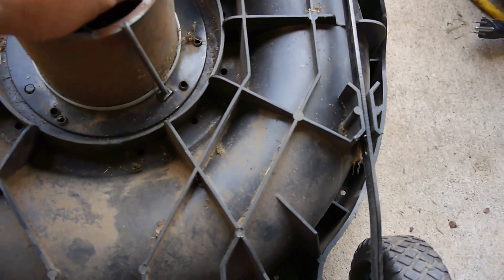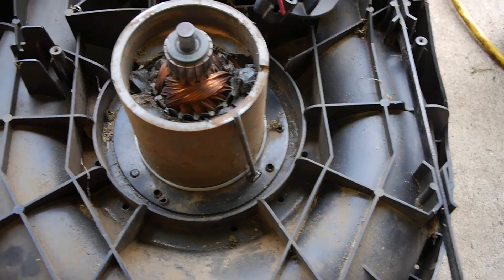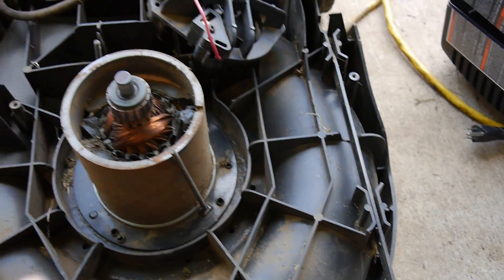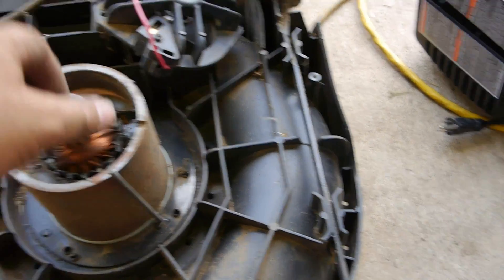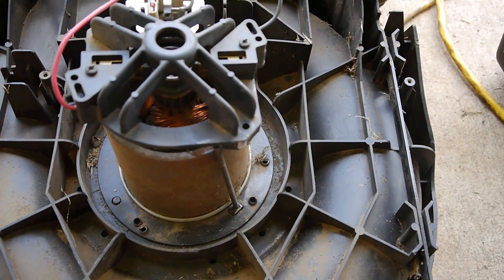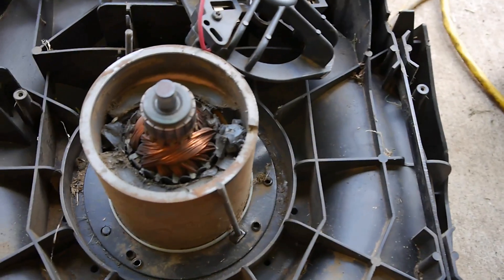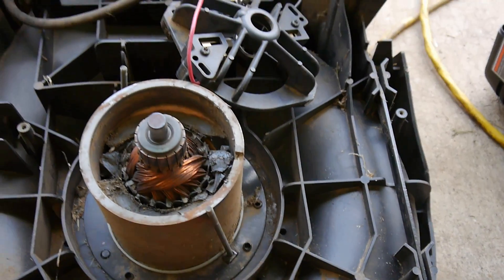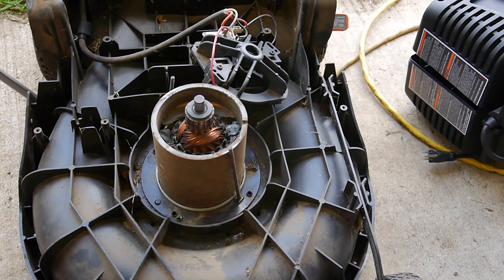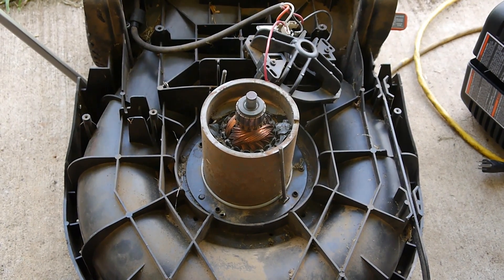This motor will definitely have to be replaced. My guess is it's either a rock from underneath that worked its way up, but it's got this little fan shroud that covers it. You can see all the junk that built up inside the housing and definitely worked its way down into the motor itself. Something worked its way in, started grinding away, and just started shattering the insides of the motor and the magnet. So if you want them to last, just keep them clean. Don't be afraid to take the housing off and clean it up — it will probably last a little longer for you. Be sure to subscribe to our channel; we've got more videos coming.